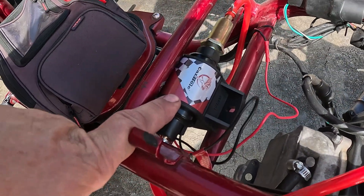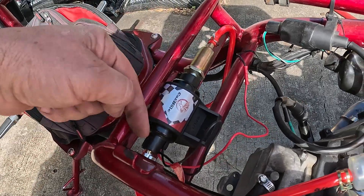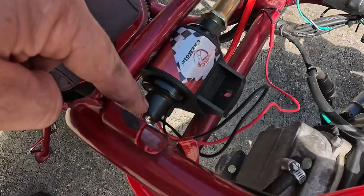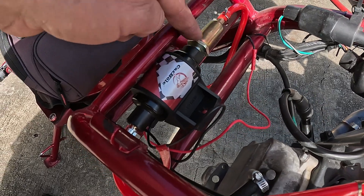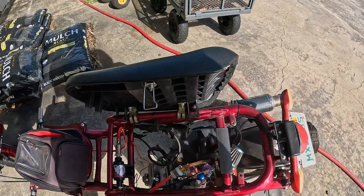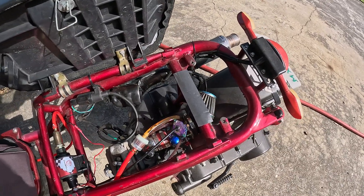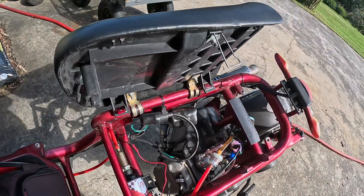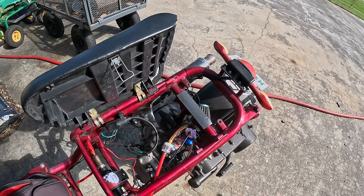It'll keep running. It sounds weird and you're thinking something's wrong, but it's staying running. It runs to maintain a head pressure to keep the fuel up here. It's not going through right now because the fuel has stopped — nothing's going through until it needs it. When the demand happens over here, it will let fuel out. But it's always going to run to keep no air on this side of the pump. We spent almost an hour starting this last time with that vacuum pump — it literally took all day. We were so pissed off afterwards we didn't even ride. Used a whole can of hot start and ended up just pouring gas in the carburetor. But with the electric pump — this thing hasn't ran in about three weeks — oh yeah, it starts right up. How nice is that?